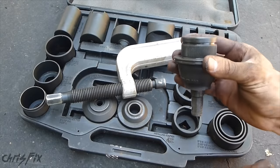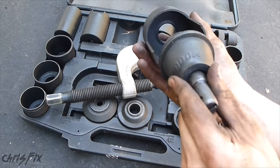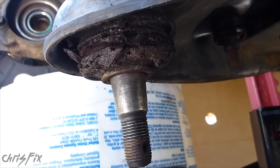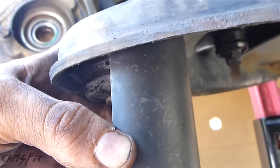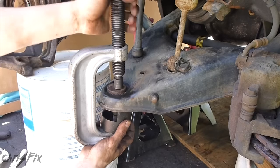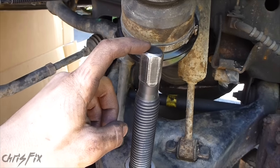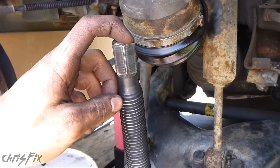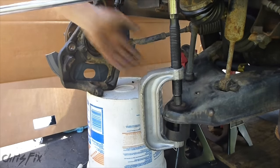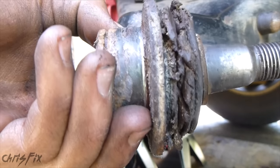Here's the ball joint press. I have the new ball joint to figure out what size pieces to use. You want to make sure the whole ball joint will fit in the receiver — the ball joint is going to press down and fall right into it. Make sure the cup fits around it without touching the ball joint, just leaning against the control arm. To see how to use a ball joint press in depth, check out my other video linked in the description. I'm going to tighten this down onto the top of the ball joint, get it centered — it's pressing on the top of the ball joint and the ball joint is going to pop downwards. I'm going to use a breaker bar and a 7/8 socket and tighten it. And that ball joint is out.